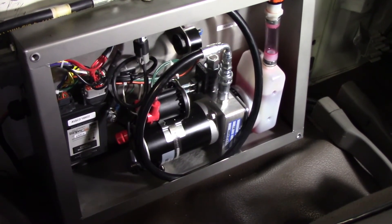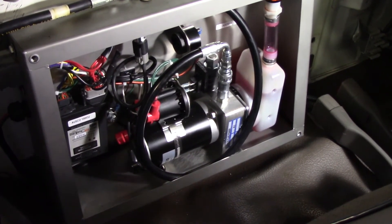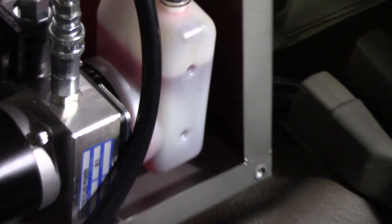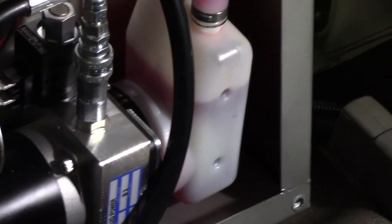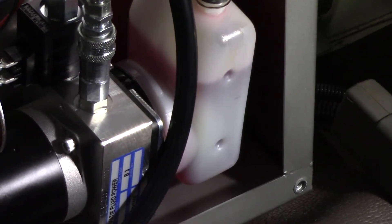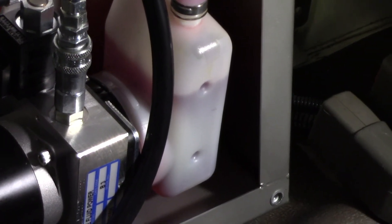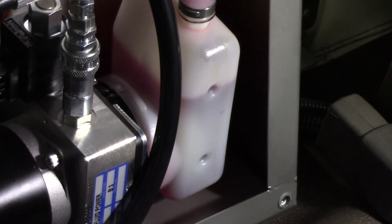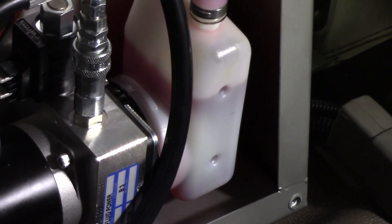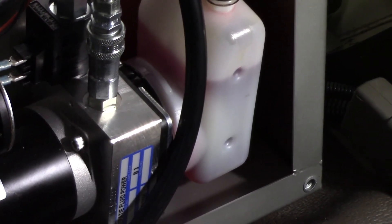Next, come back into the cab of the vehicle and check the premium pump pack. Remove the cover plate if not already done and look at the reservoir. With the pump off and the brakes applied, make sure that the reservoir is filled two-thirds full or to the top of the upper circular indentation — that second dimple in the reservoir. If the pump were running, the fluid would be a little lower because it's circulating through the system, which is why you check this with the pump off.